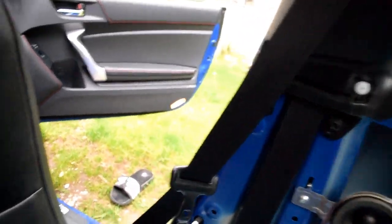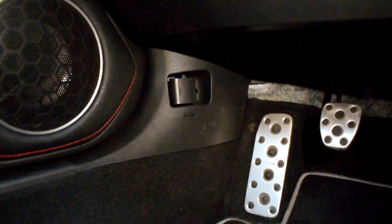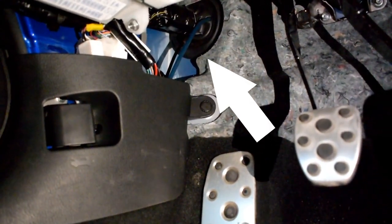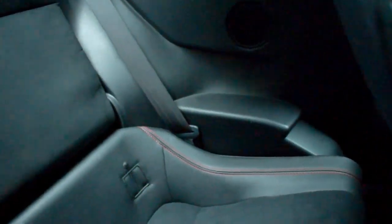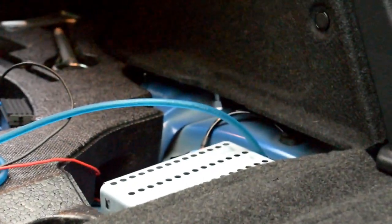It's just one huge piece. On the driver's side you're going to want to take this whole piece completely off because you're going to run all the way up to the front. Then you're going to take that piece off where the hood latch is and run the power wire, which comes in from up here. You can see it comes in through that grommet and then runs down behind that piece and all underneath the trim. When you put the panel back on, tuck the wire in behind the panel and it'll shoot right to the back.